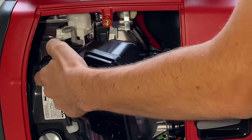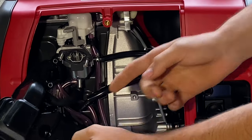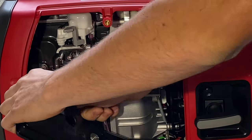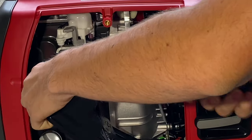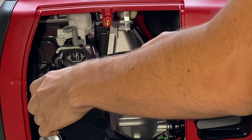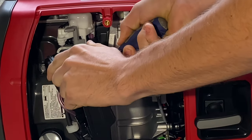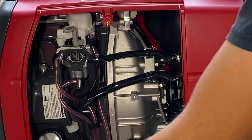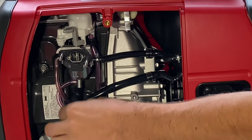You're also going to have an air breather for the crankcase right there — just leave that in there, or you can take it out. It should just pull right off. It might help to have a flathead screwdriver or some small pliers, but just be careful because the air filter housing is just plastic. And now you're left with the carburetor.